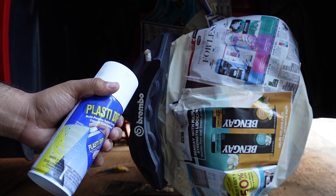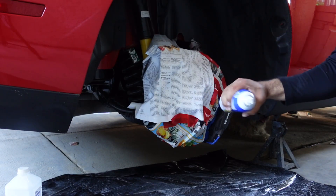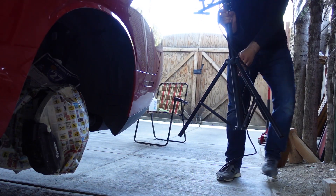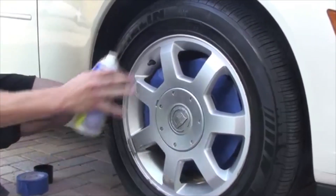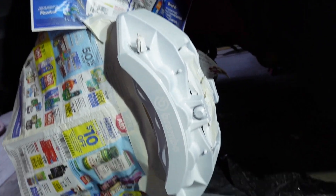We're about to start our first coat. I had my lovely assistant make sure all the cans were shaken up. You want to be five to six inches away with a nice clean sweeping motion — that's gonna help you get that even texture. This is pretty much what it looks like after the first coat. As my sensei Fonzie from dipyourcar.com would say, it's very important that your first layer is a light dusting — you can pretty much still see the Brembo and a little bit of the black coming through. First coat, always go light.